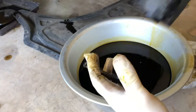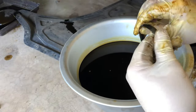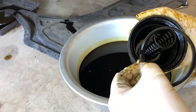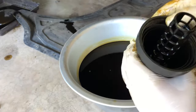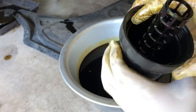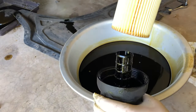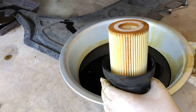I'm just taking some of the oil out of the filter housing here. This will seat right down in here with that little tab pointing up so that you'll be able to get it out when you do your next oil change. You just want to push in here to make sure that it's seated properly. We'll take our new filter and just pop it right in here, then we'll be ready to reinstall this underneath the car.